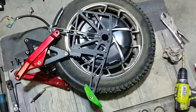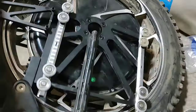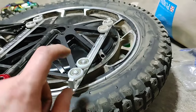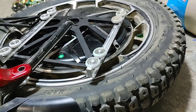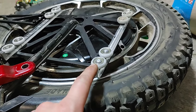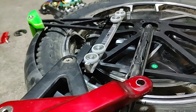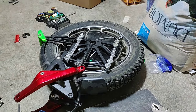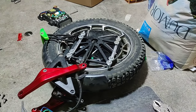A quick note from people who've seen the videos: there are little pins that stick up from the CNC slider that the bearing wheels go on top of. They only sit down maybe an eighth of an inch and you have to hammer them the rest of the way. I hammered this side as hard as I could for quite some time and none of these seem to be protruding the same distance — the ones on this other side are all sticking out a little further. The sliders are on there extremely tight. However, there's not a ton of detail in the video and no instructions, so the video is the only thing to rely on for taking this apart and replacing the sliders.